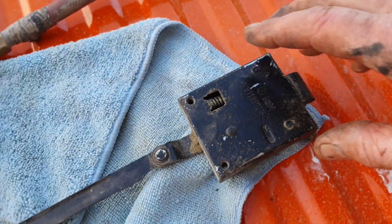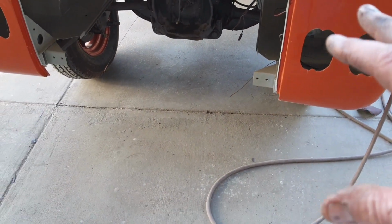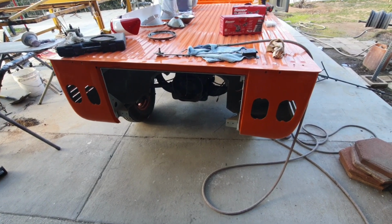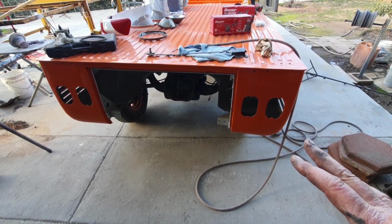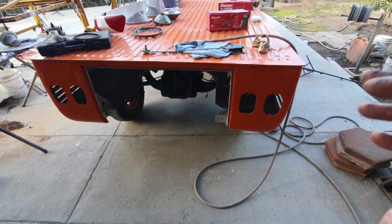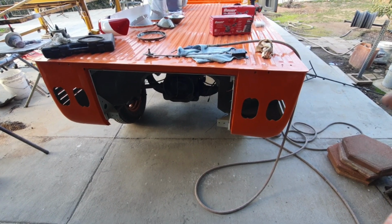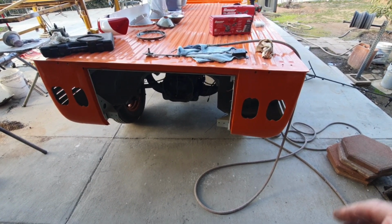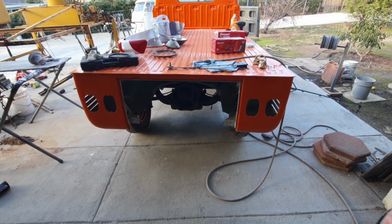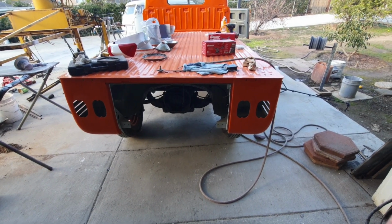So if you have something that goes on your Volkswagen that's right and left, and this is Volkswagen bugs, buses, and all that, everything, if you're trying to figure out whether it's the right one or the left one, look at the part number. They say lorry: left, odd, right, even. Lorry: left, odd, right, even. That's the old school way that guys did years ago.